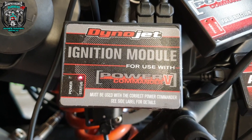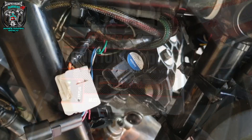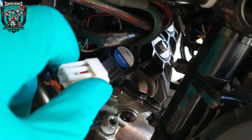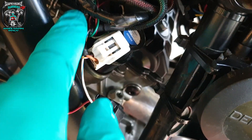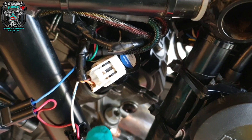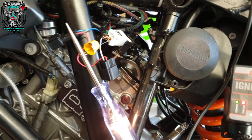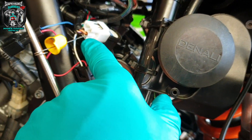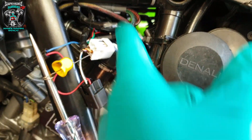I'll show you a quick and dirty way I've eliminated the bike from this equation. First, I've eliminated just one of the coils so the power commander ignition module isn't controlling this coil now - it's coming straight from the bike's ECU, not going through the power commander. I'm going to back-probe this with a test light so I can see if it keeps power when the engine stops. Theoretically it should still run on the rear cylinder even with only one of its two coils in operation.